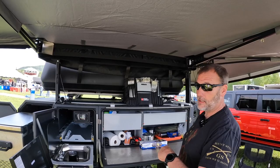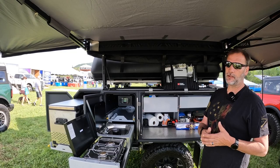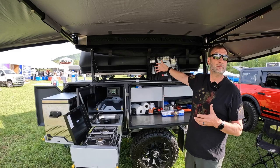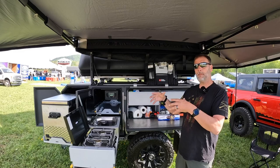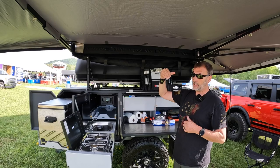If I was heavily using it I'd probably be down closer to 50%, but that's four days at 50%. Take that 200-watt solar panel, plug it in, and I'm charging all day long if I need to. While I'm at camp, I have infinite power — I never run out. If you're doing an event where you set up camp and then drive off down the road, this is set up so that when I drive, I'm charging the batteries — it's hooked up directly to the battery and alternator through the Bronco, with a breaker switch in there for safety.